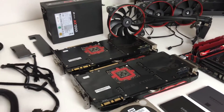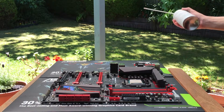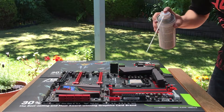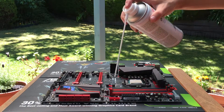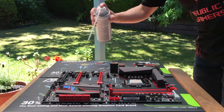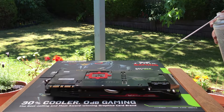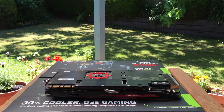It's going to be really really nice. Now it's time to dust everything off and start putting everything together. We've got our can of compressed air and we're going to start spraying off the dust. It actually was quite stubborn to take the dust off - it's very very fine dust. Even with the compressed air, in the end I found you just had to use a lint-free cloth to help get off the dust because it really stuck on there. That's the motherboard, and then here we have one of the Strix 980Ti's. You can see the dust on the back plate - only so much dust comes off with compressed air, in the end we have to wipe it off ourselves.